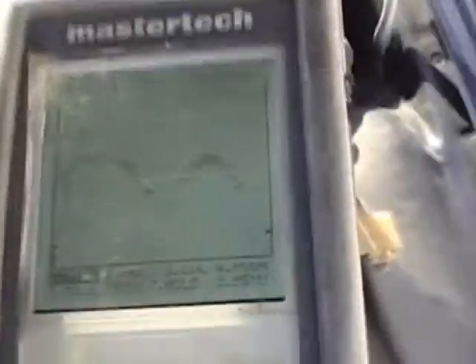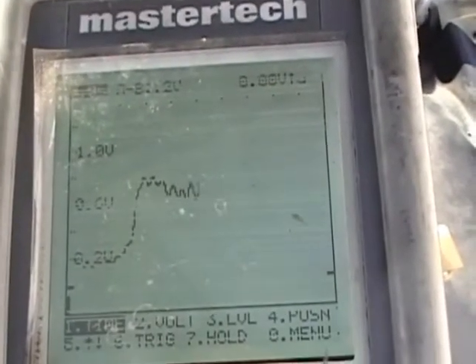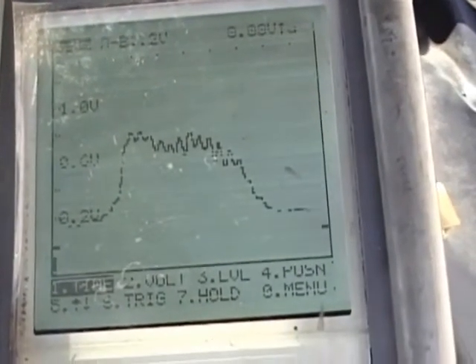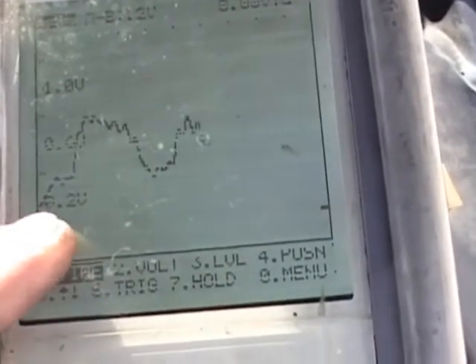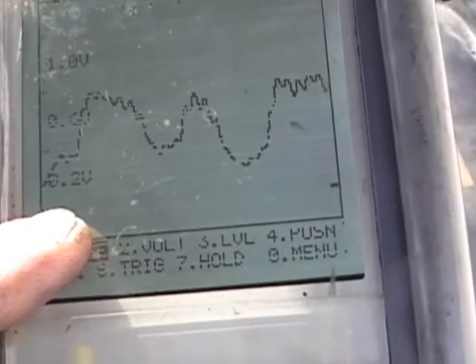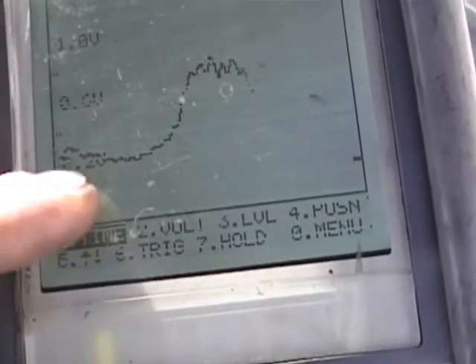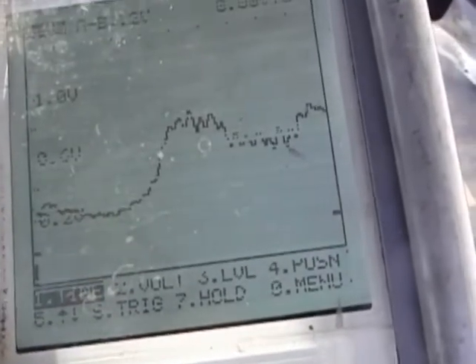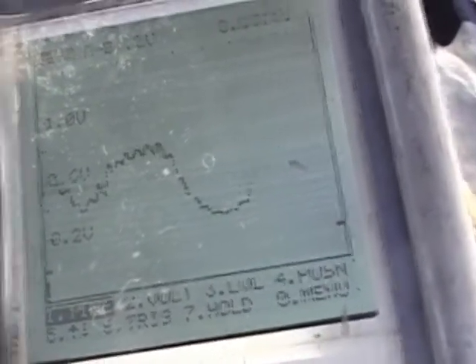I have had good results. My O2 is ranging faster, and it's actually ranging from almost zero volts up to one volt — 900 millivolts — even at idle. That's pretty awesome. It's already more accurate, and I haven't even cracked it yet.